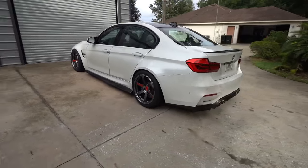It's really nice because you can see how hard you're pushing it from the tire temps, and how hard you're braking because the brakes get hot, and that heat goes into the wheel, which then goes into the tire. So it's really cool to have. I think it's so cool that a factory car has tire pressure and tire temp. It's so nice to be able to see. They cooled down a lot. We had them up to 165 on the run through. Now we're down to 130s in the front and 110, 120 in the rear.